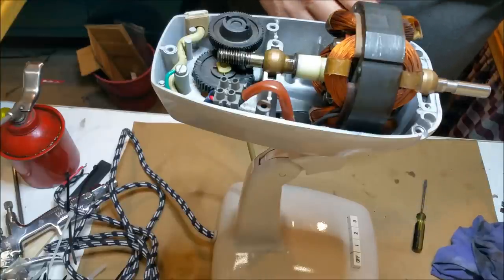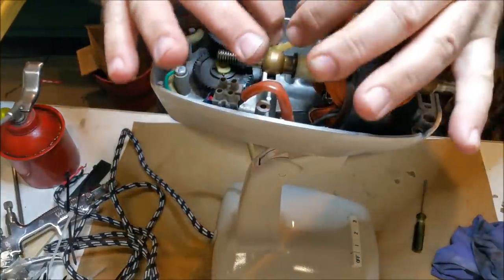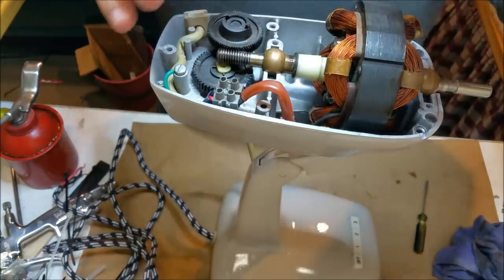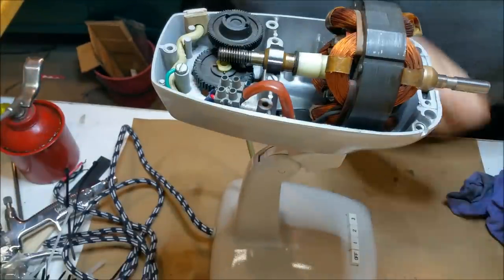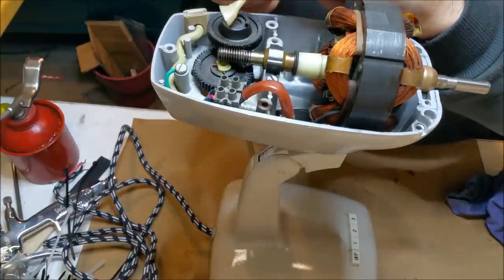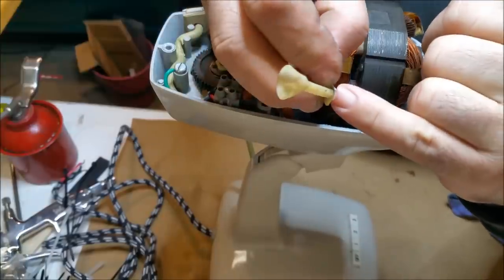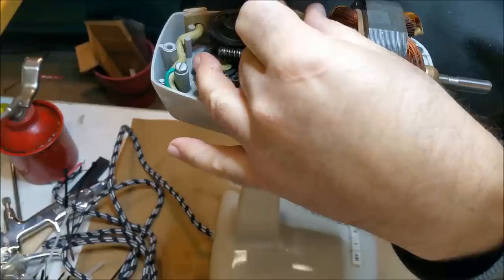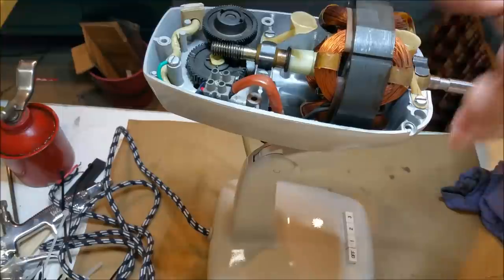The other thing is, the funnels go in a funny order. They sort of go like that and like that. So they face the center. And then the funnel goes on the other side. And it's got a little thing to stop the oil coming out. It'll drip off that extended bit there into the felt or gauze. I don't know what you want to call it. I don't want to over tighten these because they're resting on plastic.